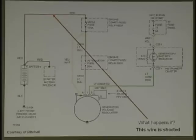Battery's going to explode. Possibility. You're going to melt the wire. Okay. And as always, Charlie is correct in saying it's a possibility the battery could explode if a short is that close and the battery is gassing. We're going to make believe the battery is not gassing hydrogen, so it won't explode. So the correct answer is it would burn that wire up, melt up, correct?